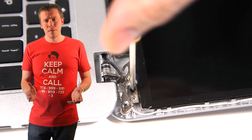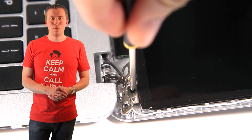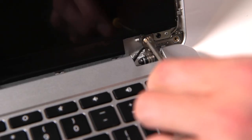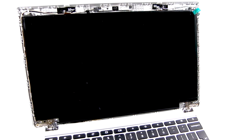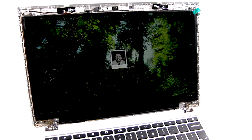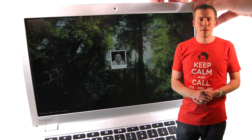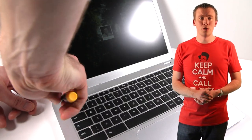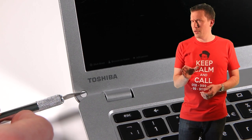Since this replacement screen does have brackets for the screws, I'm going to screw it in place with some small spare laptop screws. I've also put a link to those in the video description as it's not the sort of thing that most people generally tend to have lying around at home. Then it's just a case of reattaching the hinge mechanism if you had to undo yours, and then it's time for the moment of truth. Press the power button and if all is well you should be back in business with a lovely new display. Finally, lower the bezel back into position and snap it back into place before replacing the two screws and covering them over with the two screw caps.